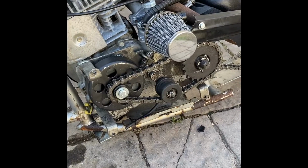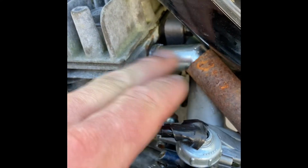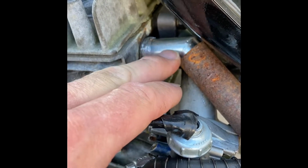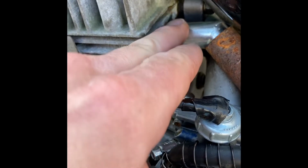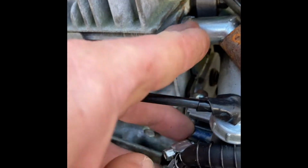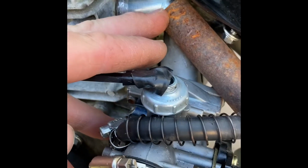All right, so I got my exhaust done. It looks really good too. I mean, you know, for what it is, makeshift exhaust. But I got a little small piece of the intake pipe that I had left over stuffed into here with a nice little aluminum gasket, which does the job. And this does quiet it down, actually. So I put a pipe on over this, and then the exit's down over here away from my legs.